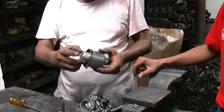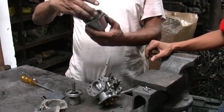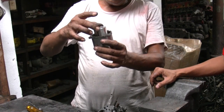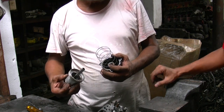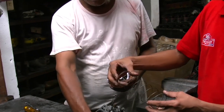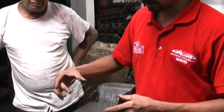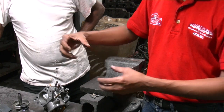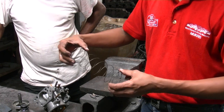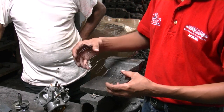It should be very smooth, with the spring-loaded thing. Are there different types of springs, or is it just one standard spring? All trial and error. What I usually do with the springs, if I need a bit more tension, I'll stretch it out like that. Then basically you get a bit more tension on it. Every time after I remove a spring from the top, I'll always stretch it a bit, so that you get the effect back.